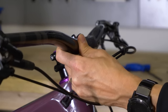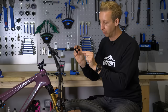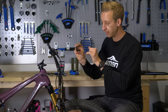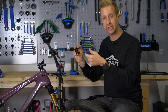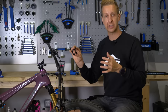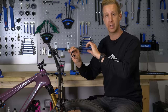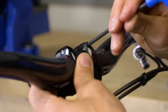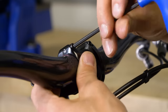Just before tightening, there's something important to note. On the cradle or front of the clamp that sits on the bars, it quite often says how many newton meters of torque you need to apply — in this case it's five newton meters. More importantly, it also says 'no gap,' meaning you tighten the top two bolts until it stops, then adjust the torque on the bottom bolts. This does differ on certain stems — sometimes it's the other way around, sometimes full contact, sometimes no contact, meaning you have to evenly go around and adjust all the bolts. Make sure you don't just pick one bolt, crank it tight, and then do the others, because that one will always end up slightly tighter. It needs to be very even.